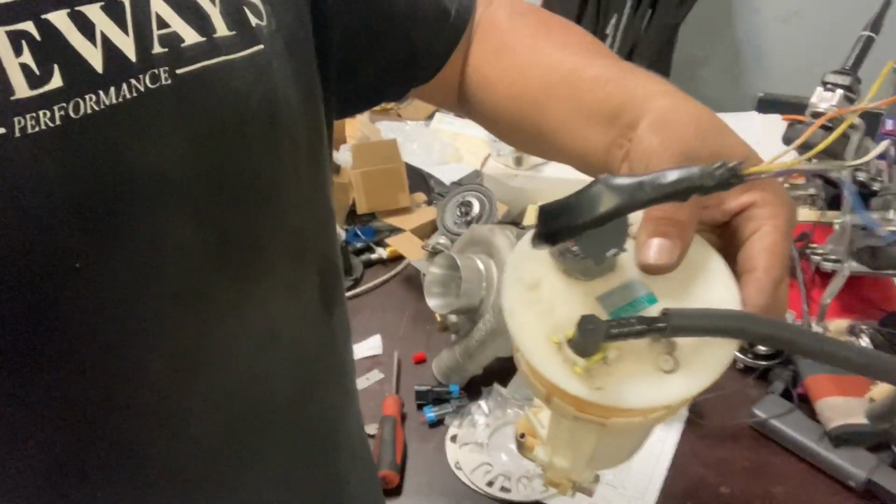You can just drill a bulkhead in the top of the tank, which you would do similar to how it is right here. Or you can just go ahead and buy the Aristo hanger that has two twin ports just like this in 5/16, and you'll be good to go. If you are going to go with something better and you need to make a lot of power in your car, you're going to have to go with the Surge or this hanger.